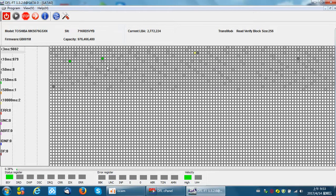After finding the bad sectors, we write down the LBA value of these bad sectors, because later we need to compare whether these bad sectors are located on the same head. More bad sectors have been found, including red bad sectors. To cut a zone, users write down the LBA of the first bad sector and the LBA of the last bad sector, then cut that zone.